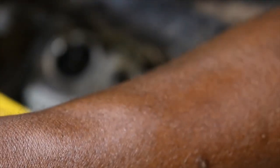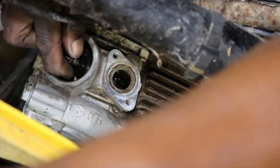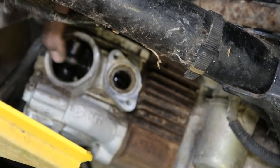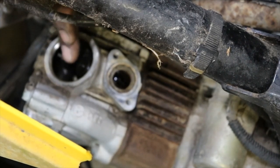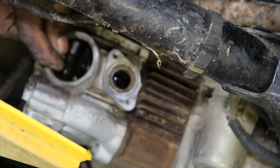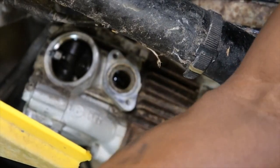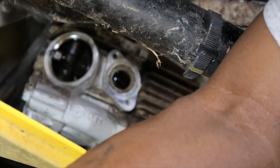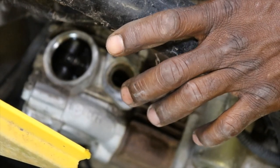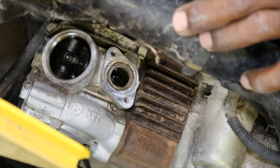Oh no. It's not even turning the valve. Look at that. Something ain't right. Either we got some bad cam or bad lifter shaft or lifter. I can see the cam turning, but it ain't hitting nothing. The lifter's just sitting here. So, you know what that means? That means that the head's gonna have to come off.